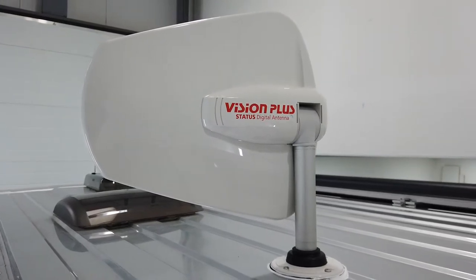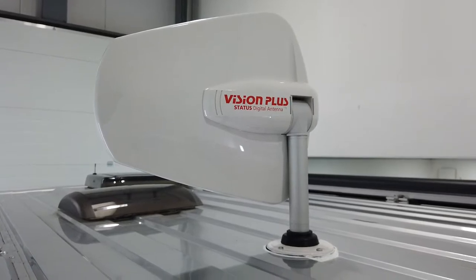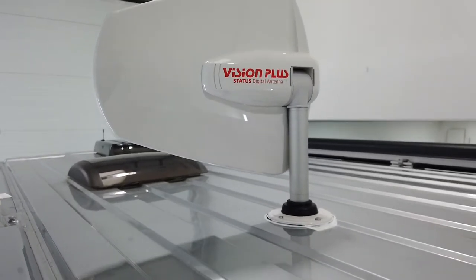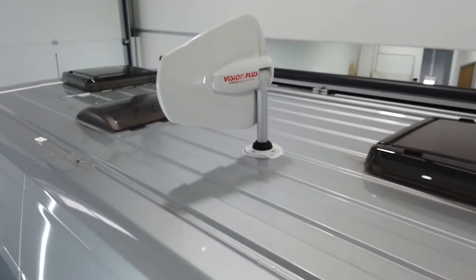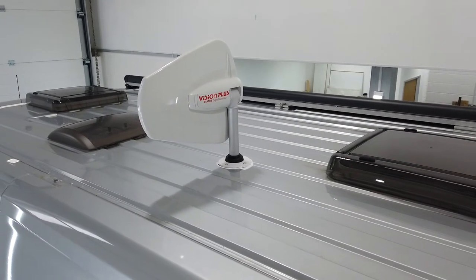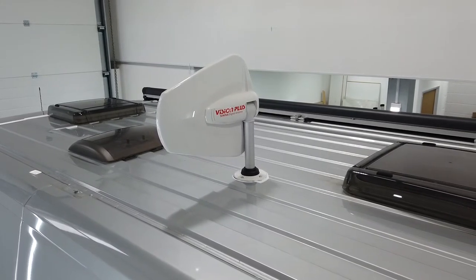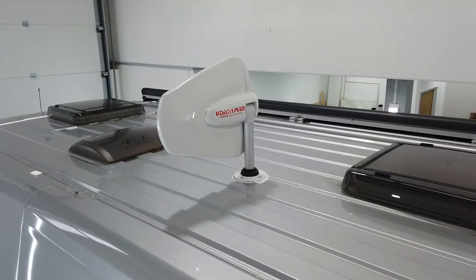At the moment the antenna is in the raised vertical position, and then using the antenna amplifier you can manually turn the antenna around and adjust the gain — a 15 decibel maximum gain — to receive your digital Freeview broadcasting or free-to-air channels. This is ideal.